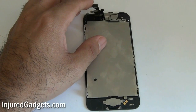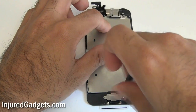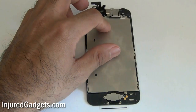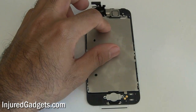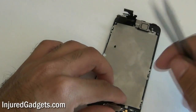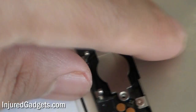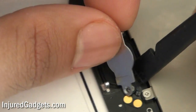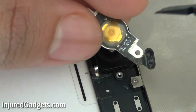I'm going to zoom in on certain parts to give you a better look. The first thing you want to do is remove the two screws on the bottom — these hold your home button bracket in as well as your home button flex cable. Be really careful removing the home button flex cable with a spudger, as it is still connected with just a tiny bit of adhesive. Use your spudger or pry tool and gently lift it up — if you don't do this gently you could rip the flex cable, and your home button will not work.